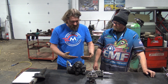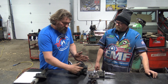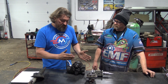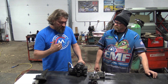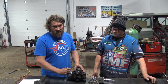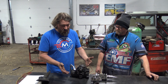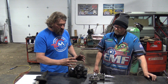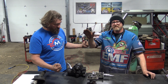That should actually move quite a bit easier. You'd assume that drag would be on the piston inside, but part of it is your groove diameter on the inside of the chamber. Two thousandths of an inch on the machining can mean a tight seal or not a tight seal. It'll still seal well, but if somebody's ripping through machining and they go a little tight it's going to cause this drag. I make hydraulic rams and I blueprint all of mine because of that. In a mass production environment, the guys are probably going to be all over the place. So when you buy a new box, your box could be different from the next box.